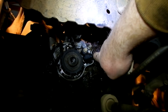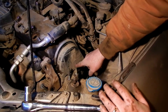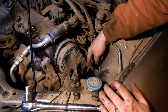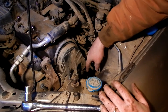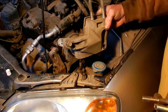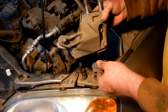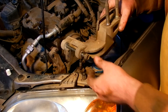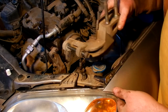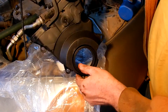Reinstall the crankshaft position sensor — it's just one bolt. Save yourself a headache and put this bracket on before you put on either timing belt cover or the lower pulley, because this is actually underneath both of the timing belt covers. Now it's time to replace the side engine mount bracket. Be sure to put these two bolts in first before you put it in position because there won't be enough room to put them in later. Make sure the alternator bracket is in place before putting this on. Now it's time to put the lower timing belt cover back on — it's just got four bolts.